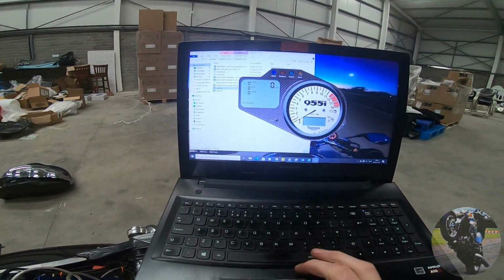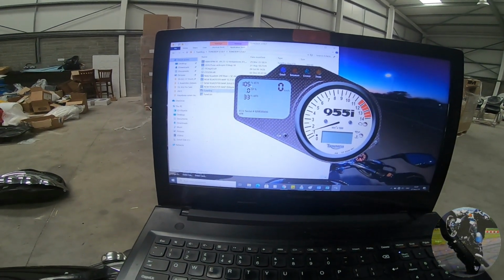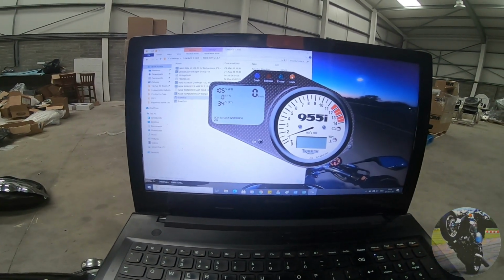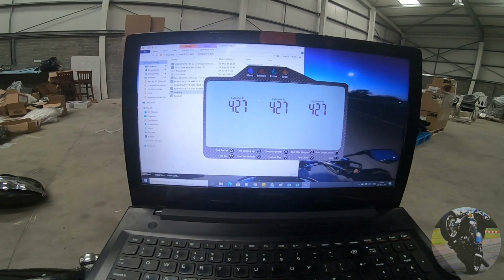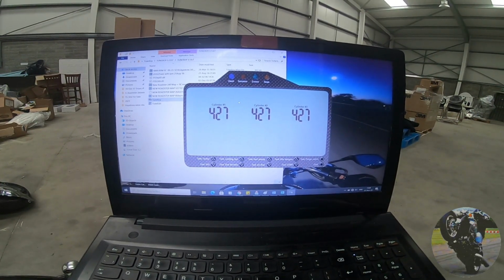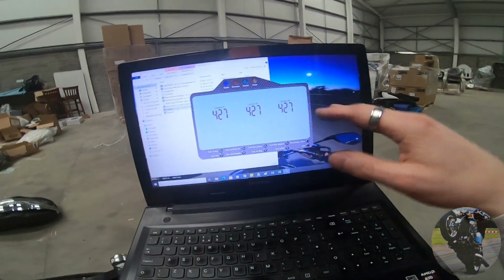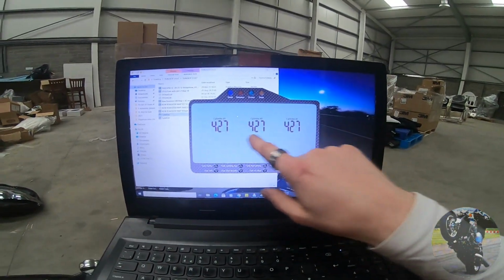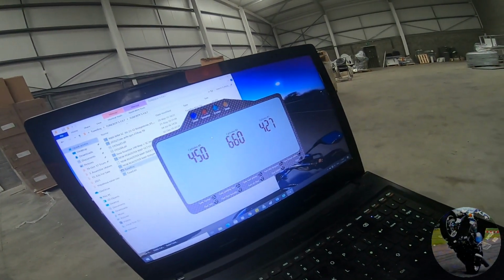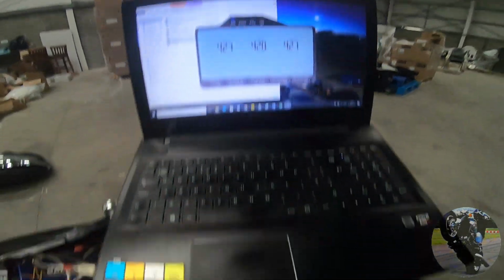So this might take a minute to connect as well. Nope, it's connected pretty good. So my fan's going to come on now because my engine temperature is quite high. So I need to go into tests, and there are my cylinders, which funnily enough has a bit more resolution in TuneBoy, I find, and it's in millimeters HG, which I think is mercury, if I remember correctly. And as you can see, I'm pretty much in balance. So that's pretty good. I'm going to go with that.